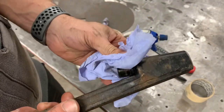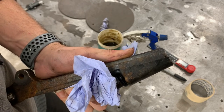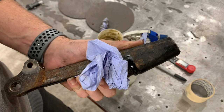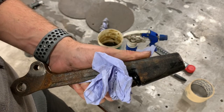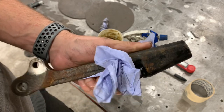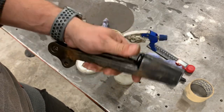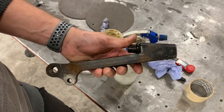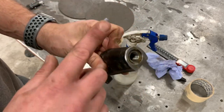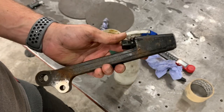Give it a nice cleanup, nice bit of deburr, bit of grease and off we go. So what you saw there - I ran out of adjustment on my camber, take five mil off, and that gives you that little bit more inward motion without losing the washer. I have to do this to pretty much every set of these I come across because of differences in cars, subframes, bottom arm bushes. You can lose a degree easily and this wouldn't go under one and a half degrees on that arm.